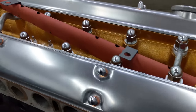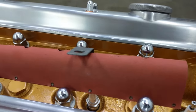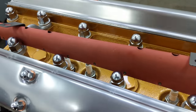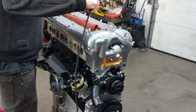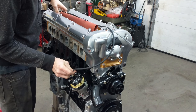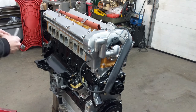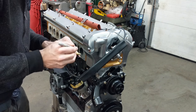Just going to get the wire set up. To do that, just put some spark plugs in the holes — just some junk ones. What I'm really trying to do is get all the spark plug wires routed through this holder. One thing I found out is that the brackets for the holder are in the wrong spot — they're for a saloon — but I'm going to go ahead and use this anyway, I think I can make it work. Just going to take a guess at the length for piston number one ignition wire, going through the hole in there, through the conduit around the front, and over to the correct place in the distributor. Just give myself a little slack just in case. I'm going to label this as piston number one so I don't get them all mixed up.